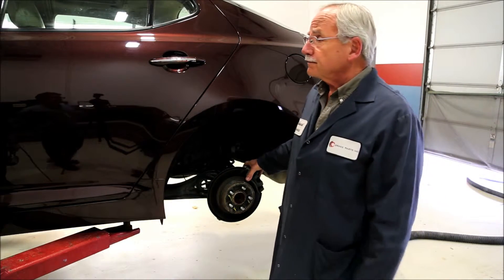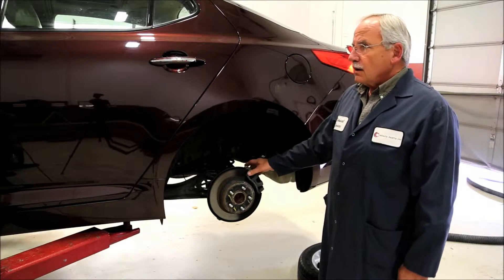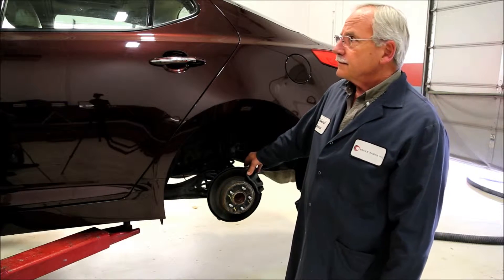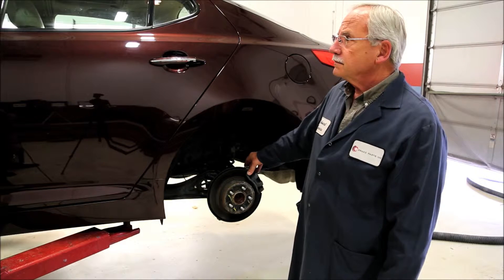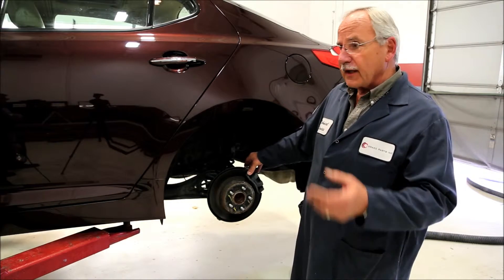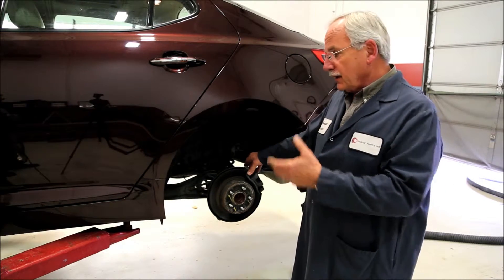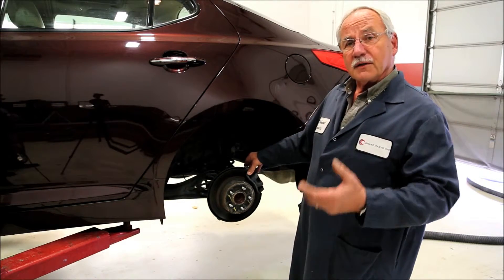Could you start the vehicle please? How's that pedal feel? The pedal is great. Okay, so we have a good brake pedal right now. That tells us that there's a problem in the vehicle by clamping it off — the problem is below the clamps.